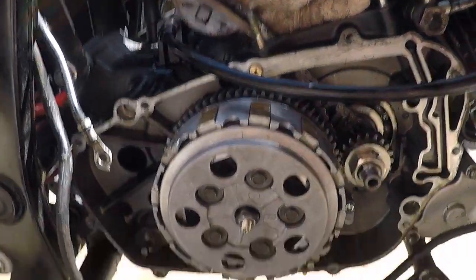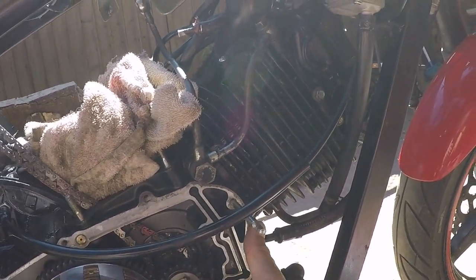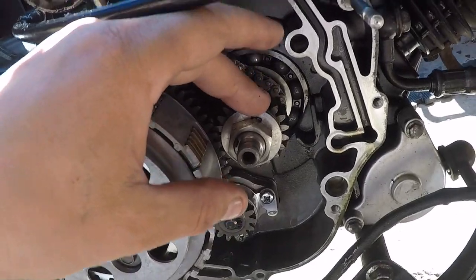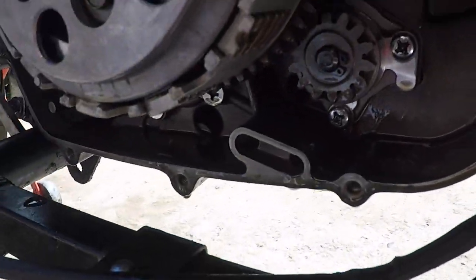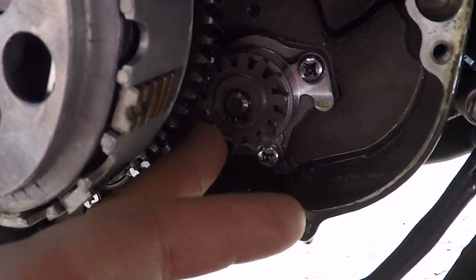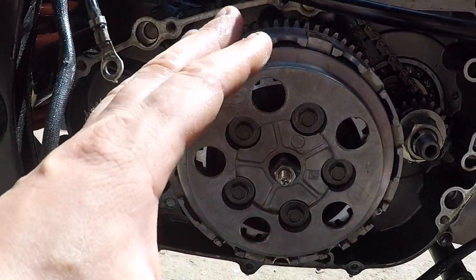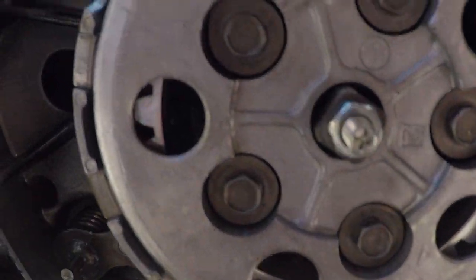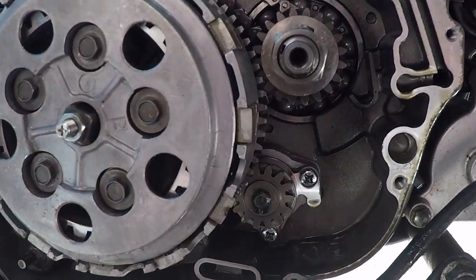So as you can see, in here you've got your timing chain under the first gear for the camshaft. That's the broken part and here's the new one we're going to replace it with. In here that's your oil pump, and this is your clutch basket with oil plates inside — I'll show you how to correctly remove it and put it back on. That's your gear shifter in here. Overall it's all pretty nice and easy, no big problems, no big work in here. Let's crack on.